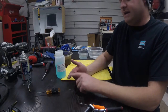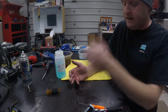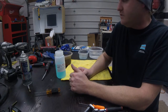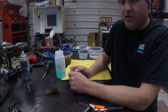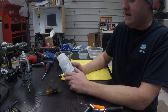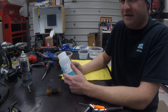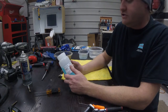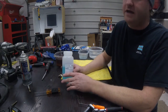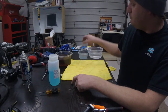Some other things people tried, and I tried too, is wire wheeling and sandblasting. I did try powder coating a couple bolt heads but I just did not like the look of it - it tended to get smudged and scratched up a little bit when torquing down the sockets. I had heard that doing the coating over a wire wheeled bolt gave a more shiny black finish, but I didn't find that to be true. Sandblasted still just looked too rough. The best thing I found is cleaning a bolt that's still in halfway decent condition, which I think gives a really nice black dull to satin finish.